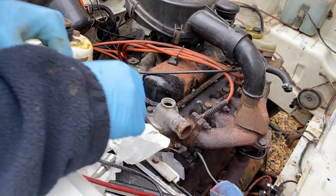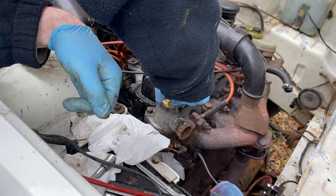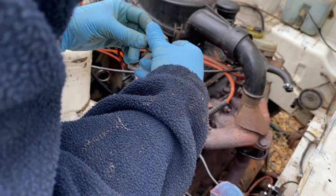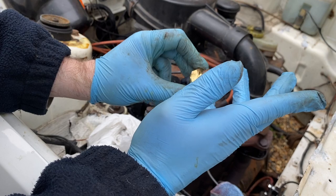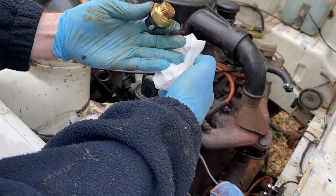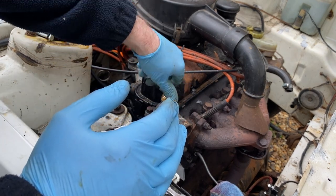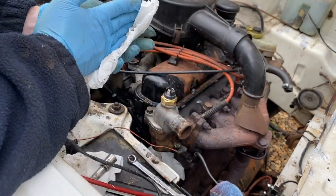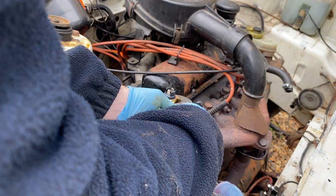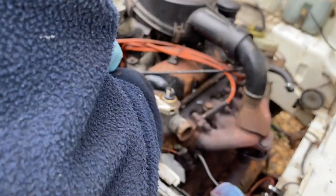Next is the fan switch. The threads are a bit unpleasant so I'll put a touch of copper grease on that as well — it was really stuck in the old one so it's really good to give it a little copper grease. I'll get my gigantic spanner and tighten that down. This is 29 millimeters. I have bought a socket that's the right size but it's a 12-point socket which might mangle the corners very slightly, so I'll gently use a big old wrench instead.